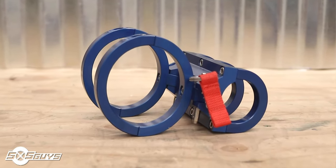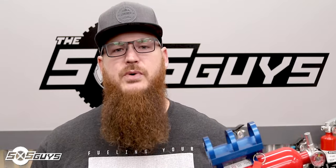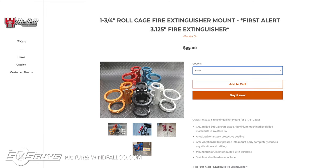What I really like about this mount is that it's so big and beefy — with triple strapping and a solid billet bottom bracket — that it can hold bigger extinguishers. Your typical two-to-two-and-a-half-pound fire extinguisher will only last about eight seconds; people don't realize extinguishers don't last very long, so the bigger the extinguisher the more capability you have. These retail for $100 from Windfall Mounts, come in multiple colors, and in different extinguisher bracket sizes, giving you great flexibility.